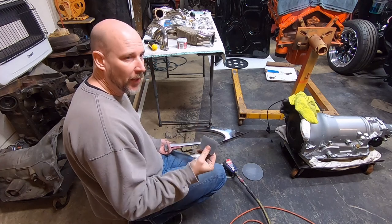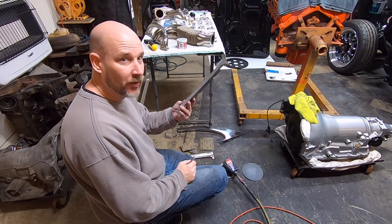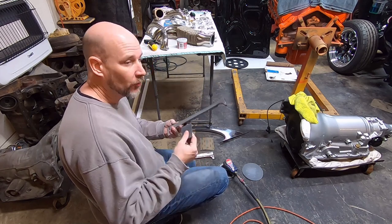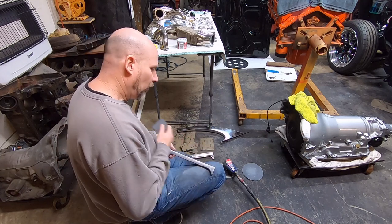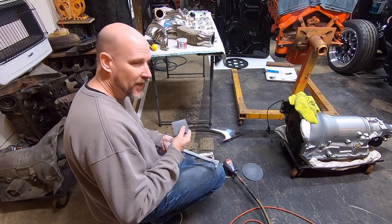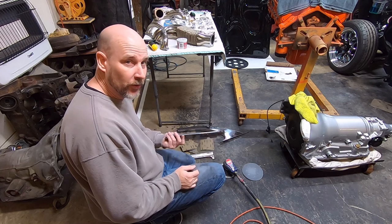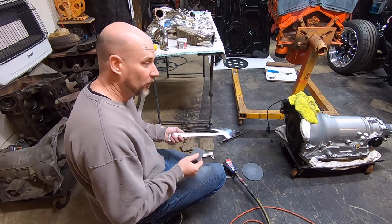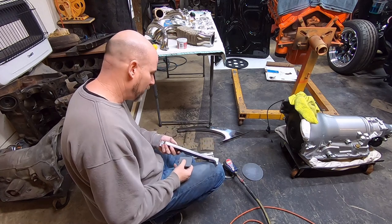The further you go in papers, the more this will polish. This will basically end up getting a pretty good shine where you can see yourself on it before you even take it to the buffer, which is really the best way to go for an instant shine. If you leave sand scratches and cloudiness in it, it will not buff out on the buffer without hours of labor trying to remove them. You can eventually get them, but if you want to do it rather quick, it's best to try to get it knocked out in paper.